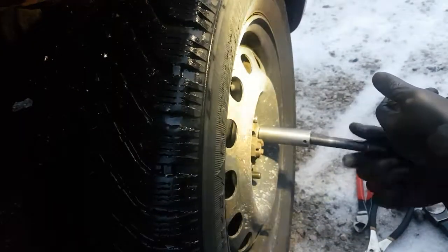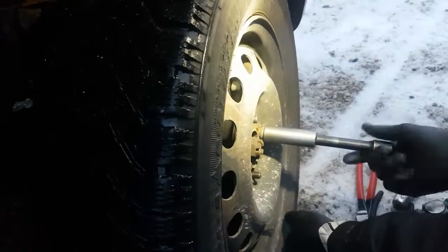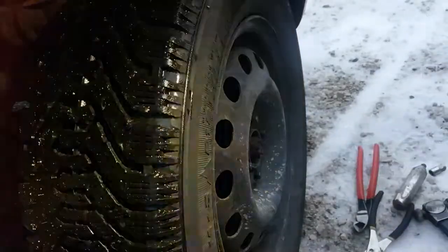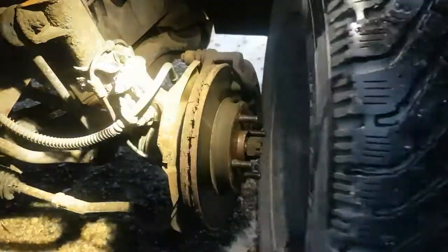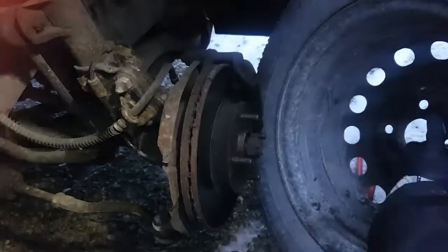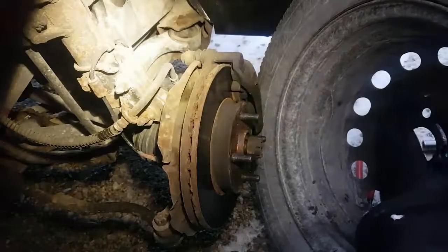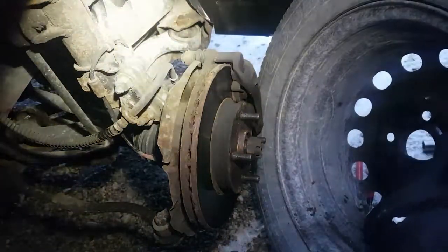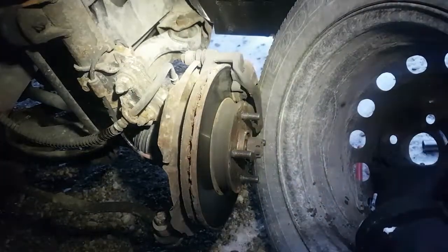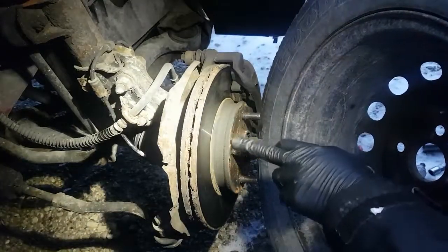Never had any lug nuts come loose. You want to know the theory behind that? Especially on aluminum rims, it is very important. When you mount up your tire, you have to make sure with aluminum rims that this area in behind here is clean of all rust. It has to be wire wheeled down. Don't use a grinding wheel or anything, just wire wheel it or hand scrape it with the end of a file or a flat screwdriver, Scotch-Brite pad, whatever. And the same thing here. All the loose rust has to be gone.